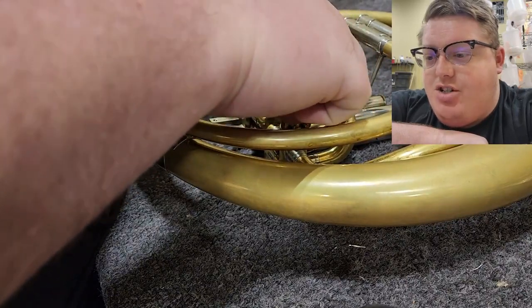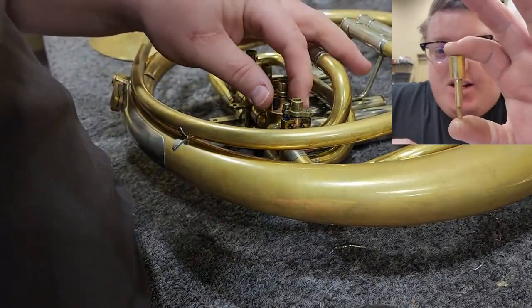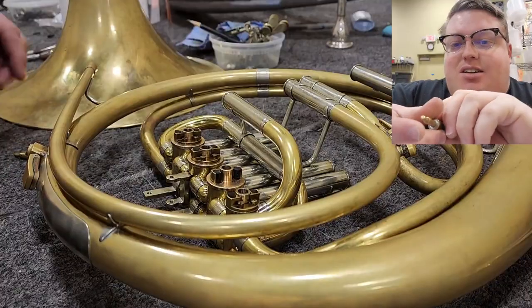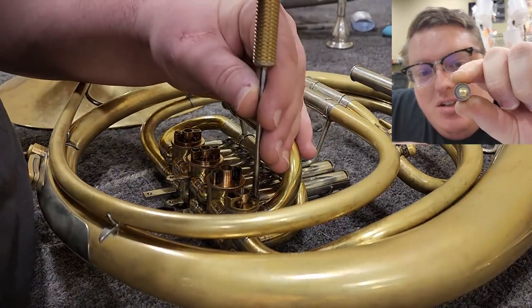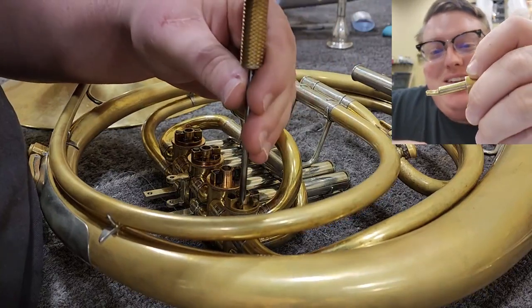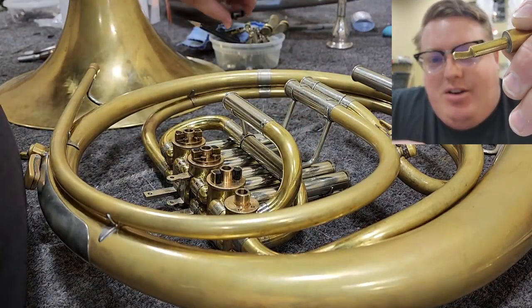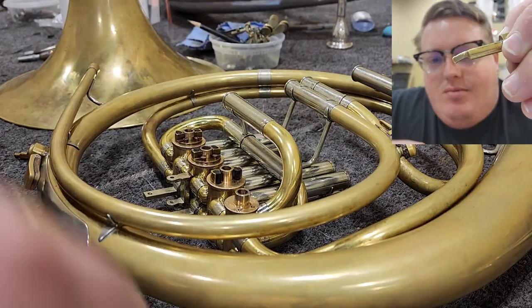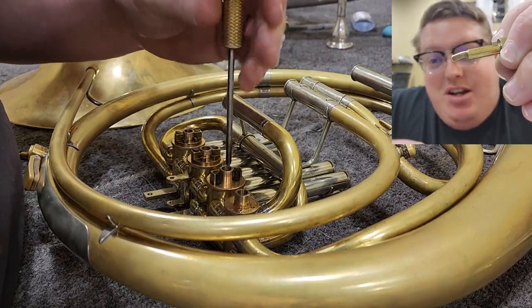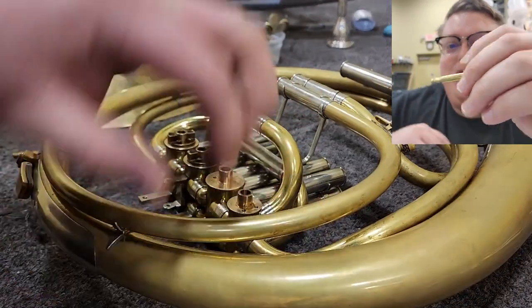I have this little punch - this is the tool that I use for removing valves. It's about to snap, but you can see the shape of the end of it. The soft brass on most valves, unless they're really in there, doesn't deform the threads or anything. Pretty crudely made, but it has served me for 11 years - it was passed on to me then and had been used for several years before that. Just a great little tool.